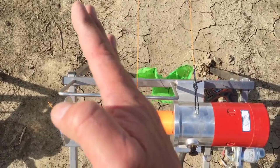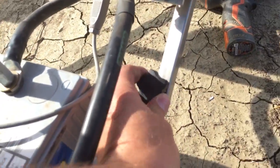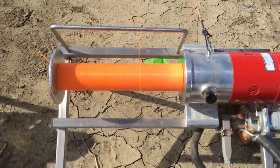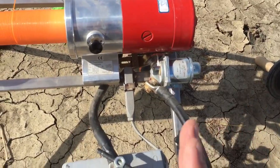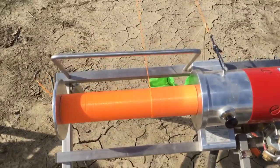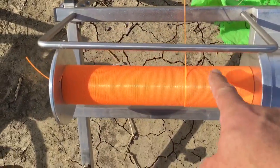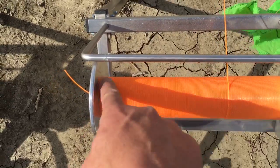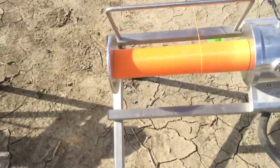If you need to make an adjustment one way or the other while the winch is under tension, just loosen one of your adjusters and your winch will shift. Loosen the one where the tension will pull it and that'll make the correct adjustment for you. Get your winch set up properly. When it's at 90 degrees under tension and your winch is anchored properly, you shouldn't have to readjust it the rest of the day. If you do have to readjust it, something's wrong.